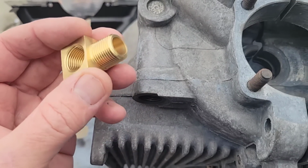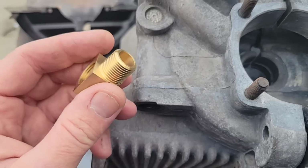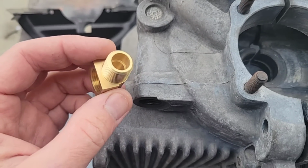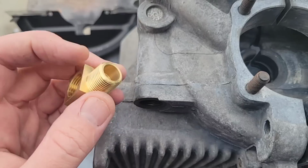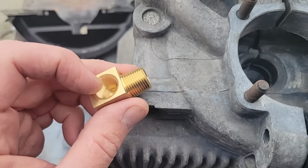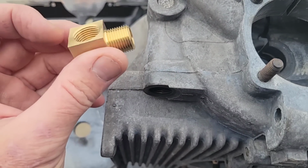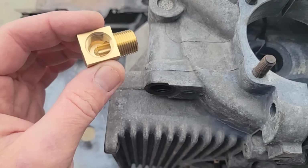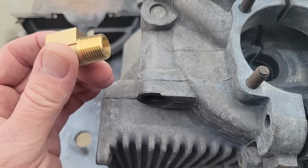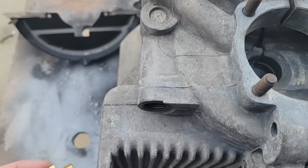You know, you have a 3/4 inch water main, and you have a 1/2 inch or 1.5 inch line all the way to the back of your property, and it still has good pressure in the back. That's kind of the theory here, is it goes through that, and then the resistance is very low when it goes through that 1/2 inch line once you get past this 3/8, and that keeps the flow and pressures really good on your system. So it works still.